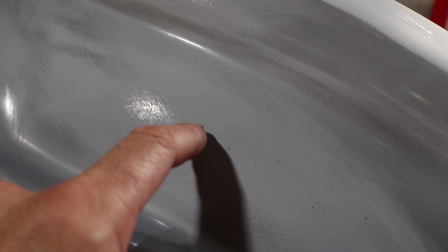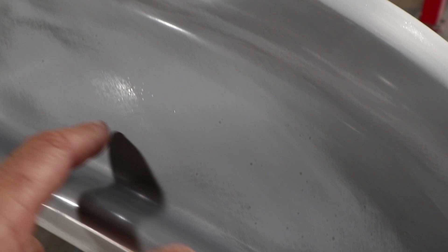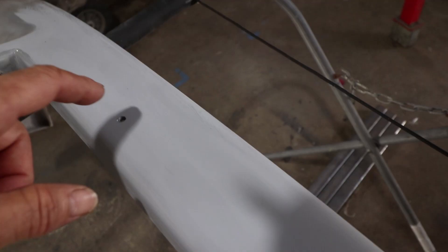That is guide coat that has not been sanded, so you can really see this needs a little bit more sanding. There are a couple fish eyes from the previous paint or maybe from the primer. You keep sanding until everything is the same color. Good examples here of just a couple divots and a scratch — all of that needs to be sanded out before the base coat can go on. That's the point of the guide coat. Definitely use it — it's your friend.